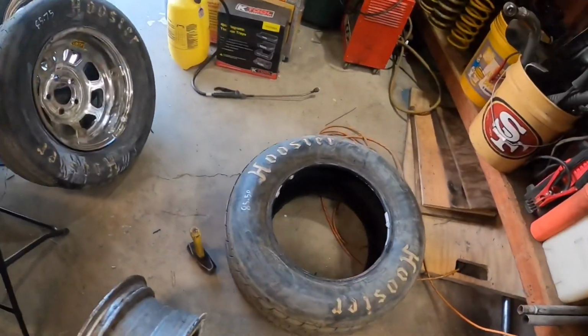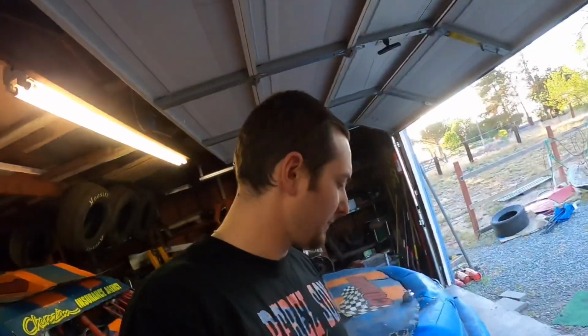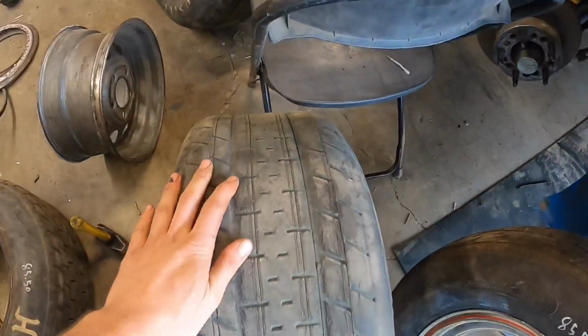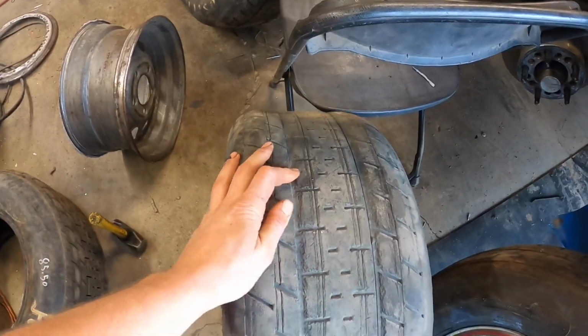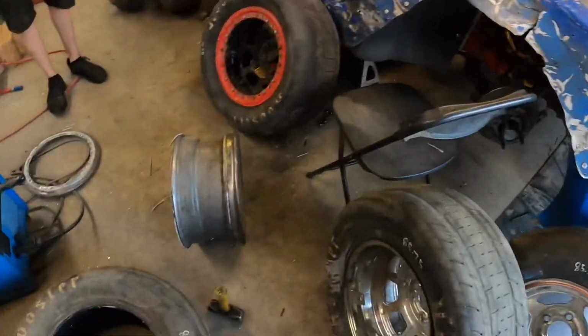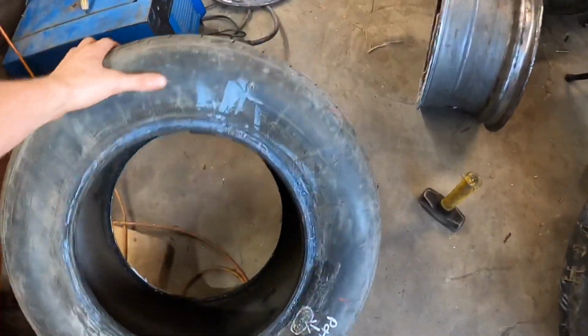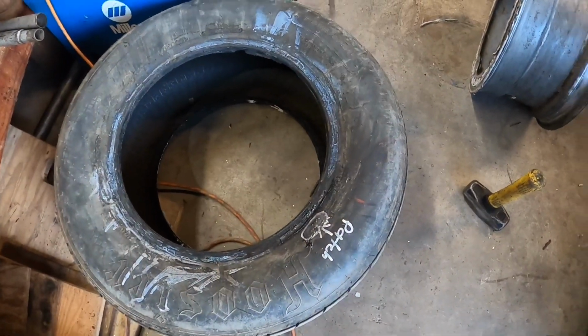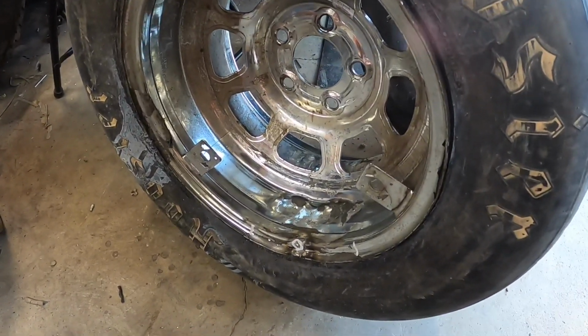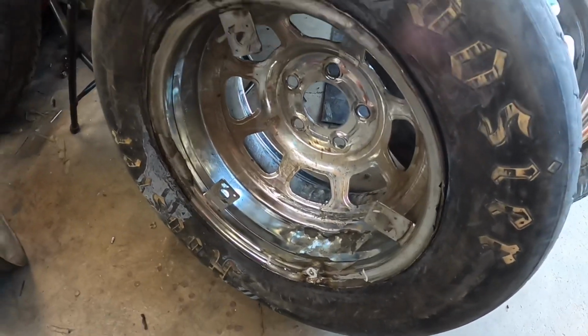All right guys, the last practice session went pretty well, but I used a bunch of old tires, stuff that looks like this with hardly any tread left, so I'm not using up new tires. It's a little easier on the pocketbook, but I burned up pretty much 3 tires. And the race before, we got our right front clobbered, and I took out the rim and put a little pinhole or slice in the tire. We're trying to fix that up right now. I ended up taking a sledgehammer and a rim wrench to the rim, and it's close. I don't know if it's gonna hold, but we're gonna give it a shot.